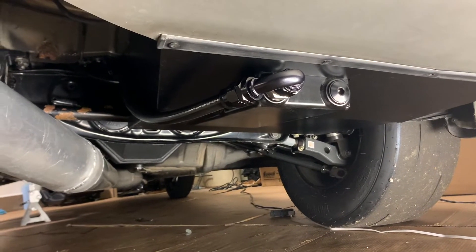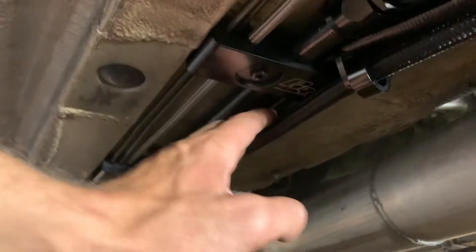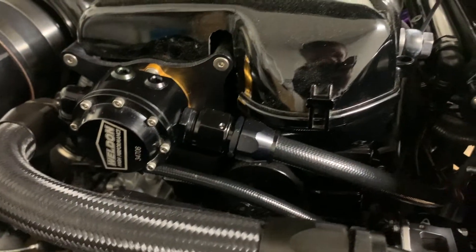So fuel system is basically done. We did the 150 degree fitting here — it's going up there where I'm actually running a check valve, and then over the subframe into this filter with a 45. It looks a little bit low, but the exhaust is way lower, and shouldn't have any issues there. Lines are nicely ran through the Powerhouse brackets. These two lines here are for the transmission fluid pump. I might try to get some different brackets to hold those up, but there's the nitrous line and the fuel line going all the way up to the engine bay. We have this 12 AN going into the pump here — a nice straight shot into it instead of the 90 that I had there before, so that'll help as well.